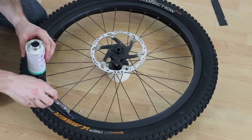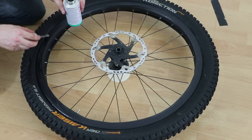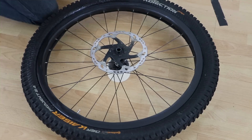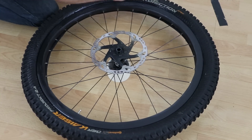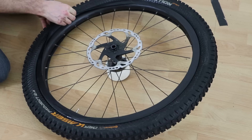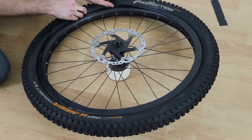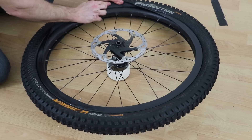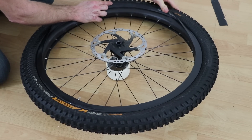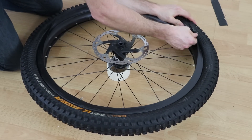This next step is where it starts to get a little bit different — if you've skipped forward to this bit, welcome back. This is when we get our rubber cement and apply it around the rim. You want a nice even coating on the flap of inner tube that's hanging out and on the tyre sidewall. Go around the rim and once you've given it enough time to dry, stretch the inner tube back over the tyre and it should stick instantly. When I say stretch, I don't actually mean fully stretch the inner tube — I mean just pull it up and over. If it starts to stretch, the elastic effect of the inner tube will start to pull against the glue, so you want it to naturally fold over and just rest against the tyre. Try not to get your fingers on the glue, but as long as you've left it long enough to dry and you've got a nice even coating it should stick with no problems.